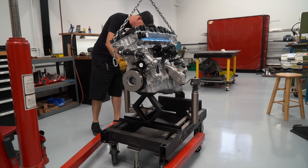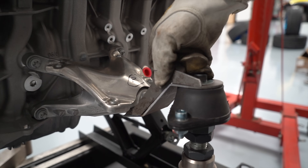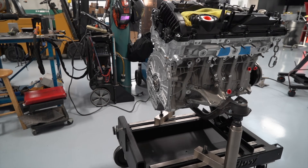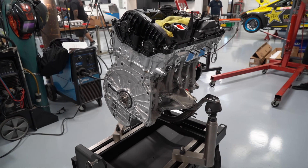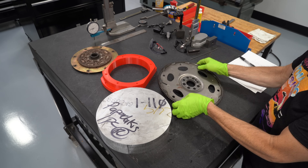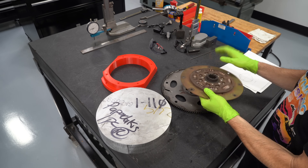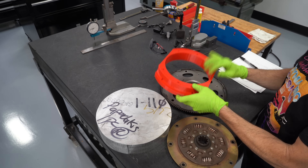We had to actually make everything. Back at the shop, the first thing we had to do was get the motor mounted onto the dyno cart. This cart allows you to move the engine around and also work on it. We fabricated a steel crossmember that mounts to rubber isolators on the Superflow cart. Then we had to figure out the output shaft adapter, which adapts to a clutch disc but doesn't have any friction surface — it actually bolts straight to your flywheel.